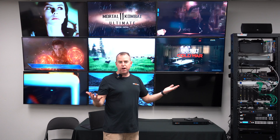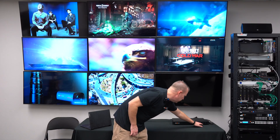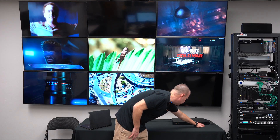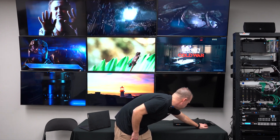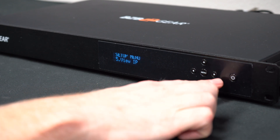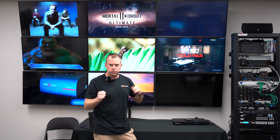Today we're going to show you how to connect it to your local network. We have it already connected to a network switch and already ran a cat cable to our local network. Just go to the front of the unit and double-check your IP address, because DHCP is on out of the box — that's option number five, View IP. It is on our local network via DHCP at 192.168.30.87. So let's go ahead and jump into the computer and connect to that so we can start controlling.